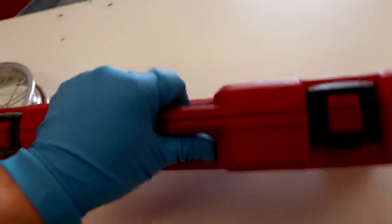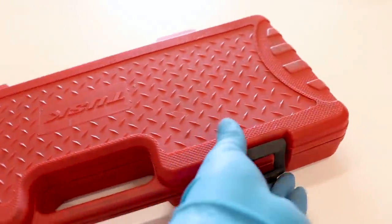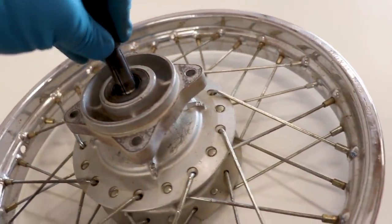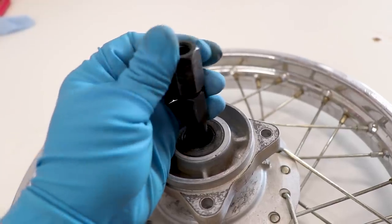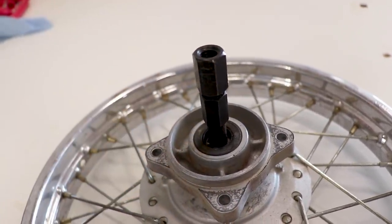So I'm going to do that first actually. Now this is what I use for pulling out the bearings - it's called a blind bearing puller kit. It's like a slide hammer and it's got these individual little collets that slide right into the bearing. It's popped right in there. You tighten these two against each other and it pretty much just locks that adapter to the bearing. And then you use the slide hammer to yank that out - pretty simple.